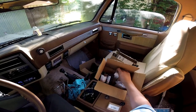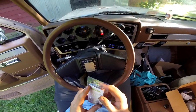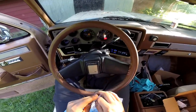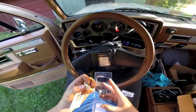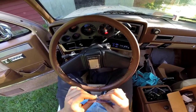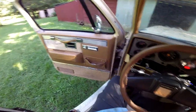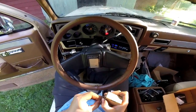I did go ahead and get a few different brands to test, and there are apparently different colors available - I just got white bulbs. I'll also be putting them in the taillights, which use the regular 1157 bulb for your turn signal, brake light, and running light, but it also has one of the 194s as well. Your cornering lights in the front are yellow and also use the 194. Your reverse lights are 1156 bulbs. Your front turn signals are also 1157s.